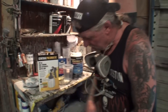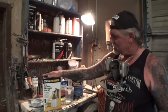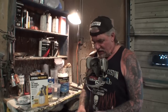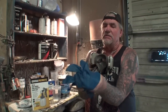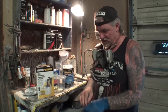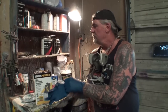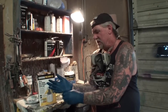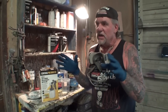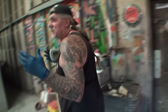We're going to go inside the paint booth and I'm going to show you the type of material we're going to use in our Central Pneumatic 33-ounce low volume low pressure spray gun. It's well worth twenty dollars. Quick question: would this gun be good for a Rhino Liner type situation? Nope — this is only for a sprayable liquid product like this. It takes a different type of spray gun to spray a very thick product like Rhino Liner.